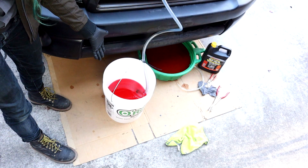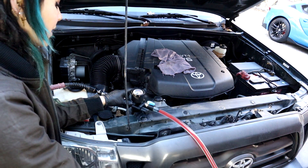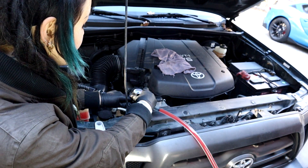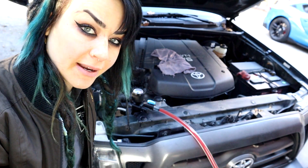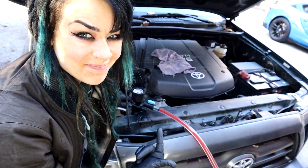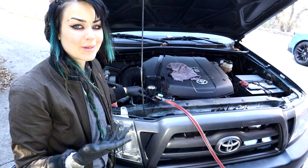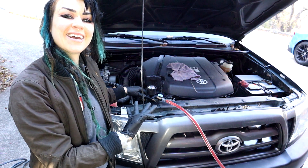From here, I've got my hose and my bucket ready to go, and now I'm going to open the valve. The whole time that coolant is getting sucked back into the system, you can see my upper radiator hose is sort of coming back to life and the coolant level is going down in my bucket. The whole time I'm making sure I hold this steady on top of the radiator so I don't let any air bubbles get in there, and I'm also making sure my hose does not get to a point in the bucket where it could actually suck in some air. Now, the cool thing about this is that the suction actually forces the thermostat open, so I don't have to worry about burping any air bubbles out of the cooling system after this. This is pretty much one and done — isn't that beautiful? Think back to my last video and how many steps it took to get the entire cooling system flushed out and then purged of air. See the advantage?